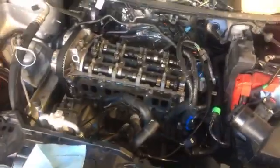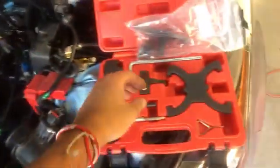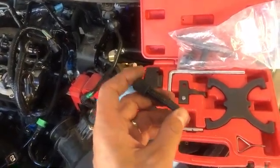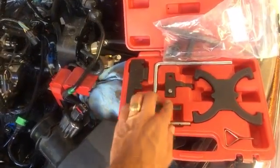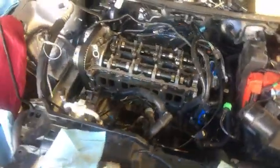Hey guys, welcome back to Electrical Car Repair Guys. In today's video we'll show you how to find top dead center (TDC) on Ford vehicles. This will apply to most newer Ford vehicles, especially the EcoBoost turbo engine, but also the 1.1 and 1.6 regular engines in Europe. For the 1.6 EcoBoost we'll be using the timing kit which comes with the TDC pin as well. If you have a different engine, the pin length might be different, so always double check. We'll have the links listed in the video description.